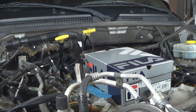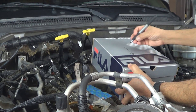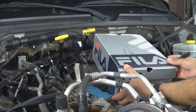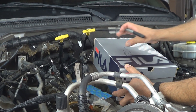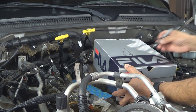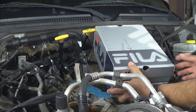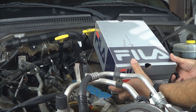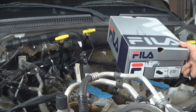Keeping things organized is crucial for the next steps. One of the things you want to do is find yourself a small box and put an arrow showing where the front will be. What you're going to do is place the lifters and rocker arms in their original locations in the box as you go, from front to back. As you remove each one, place them accordingly. That way when you reassemble this engine, you put the components back where they were. So make sure you find yourself a box and mark it.